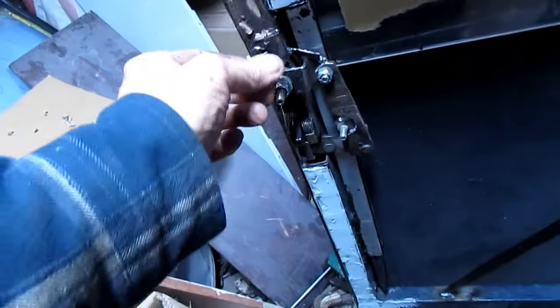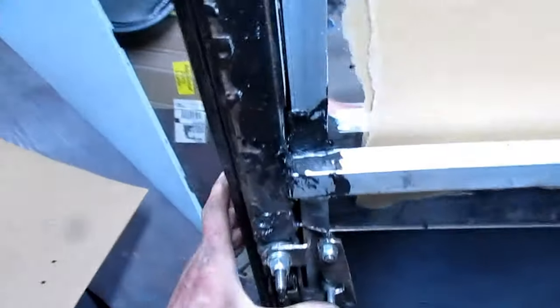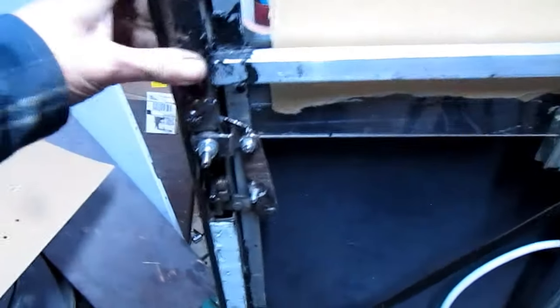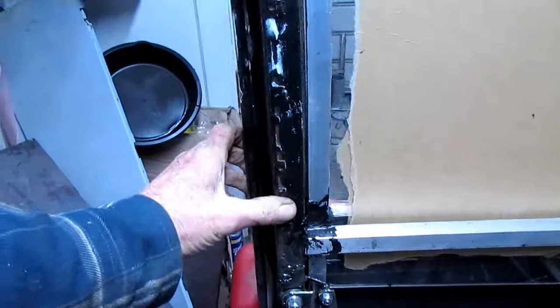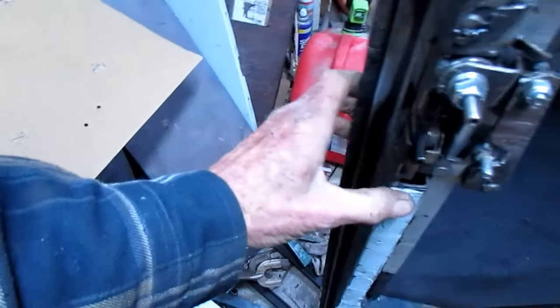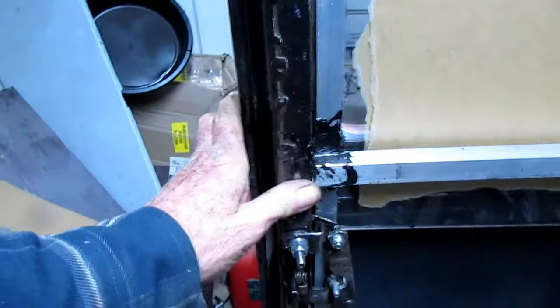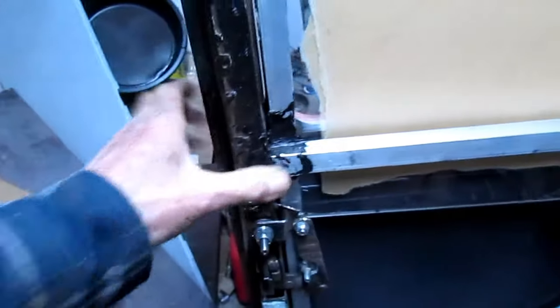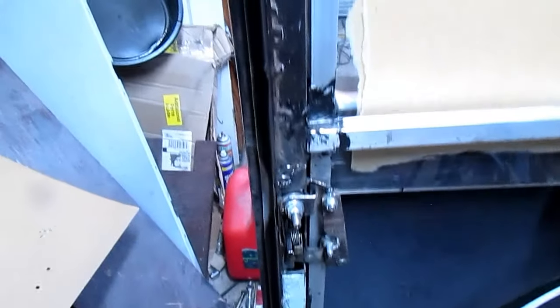It's not the prettiest, but I've got to clean up this whole area right here. For now, it looks like I've got everything all cut and parallel. I'm going to fill this window channel here with a little bondo — I'll grind it all off first. I did it down here on the bottom. I'm trying to get a 32nd of an inch here, so this all needs to come out just a little bit so it'll be flush. I might as well make this straight out of bondo — then I can drill some holes in it. I'll do the same thing up here on top.